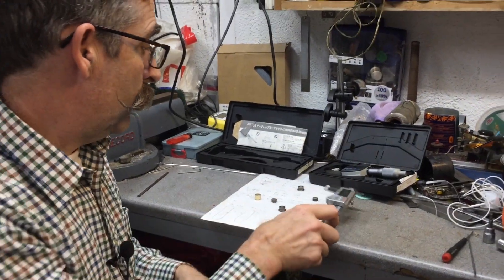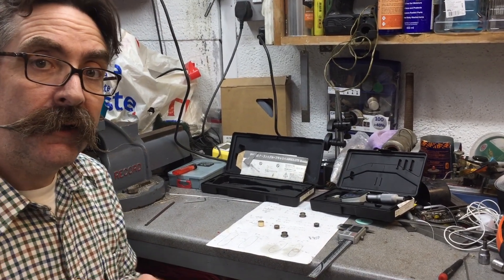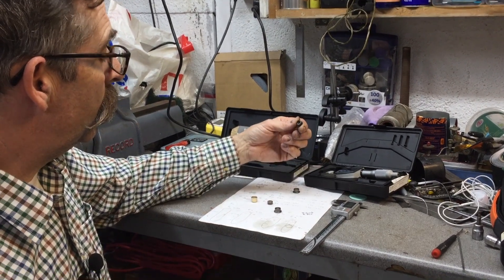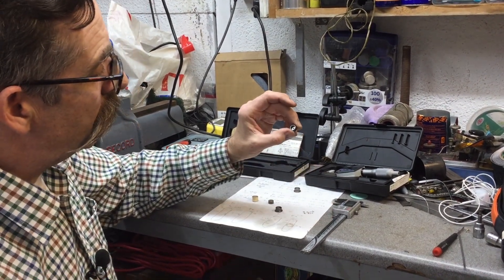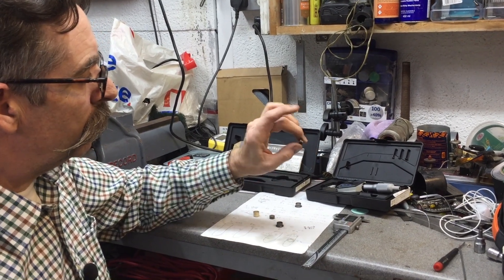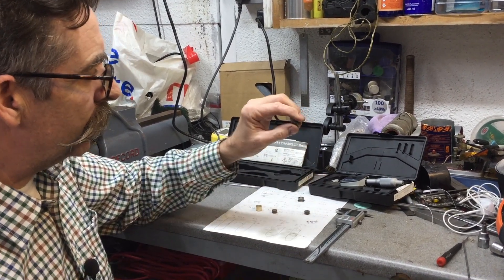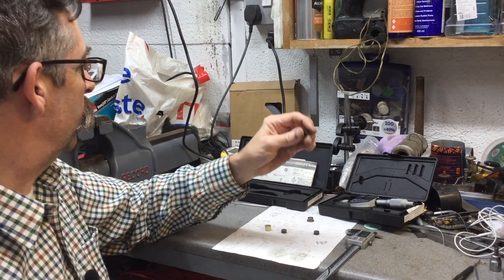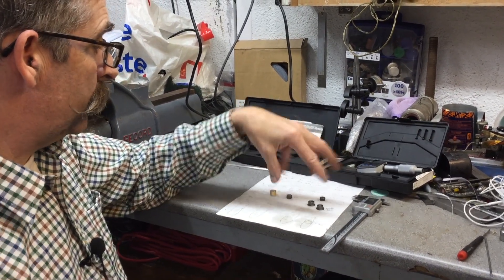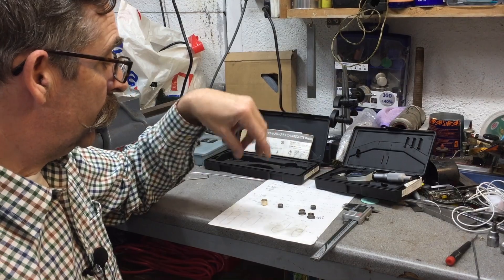Then with a bit of school maths you work out what sizes you need, and go and see your local Ducati spares department and give them some cash because they're not cheap. I went to a local Ducati dealer — these openers are about nine to twelve pounds each and the closers are about 24 to 27 pounds each. So yeah, measure them all, have a swap around. I managed to find that I had four that I could use on other cylinders, and then I just needed to buy four new ones to complete the set.